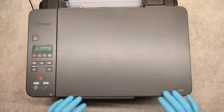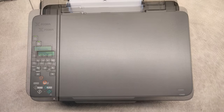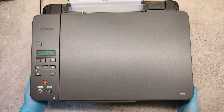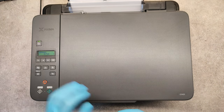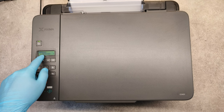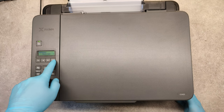Be sure all of the tanks are filled before proceeding — yes, OK, and then yes, OK. We are waiting about six minutes. After about six minutes of ink flushing, let's see what happened. If everything is OK we will print a nozzle check in the same menu under maintenance — when you see nozzle check press OK.